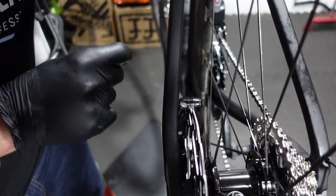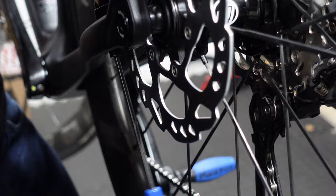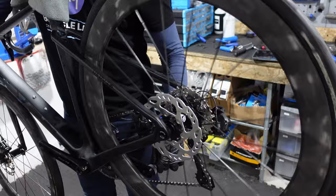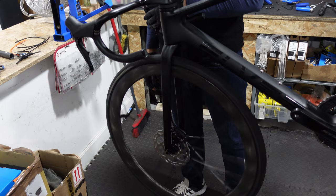Aligning the brake calipers is the next crucial step for effective braking. Francesco employs a simple trick: using a piece of paper to better visualise the gap between the pistons and the disc — simple yet effective. We start with the rear caliper, adjusting it by hand to position the brake pads at equal distance from either side of the disc. Once satisfied, he pulls the brake lever to confirm both pistons are contacting the disc simultaneously. After adjusting both calipers, ensuring even contact with the brake pistons, both levers feel really good with equal lever pull.